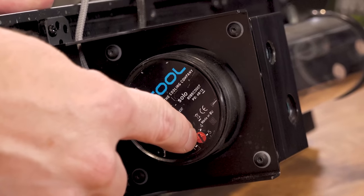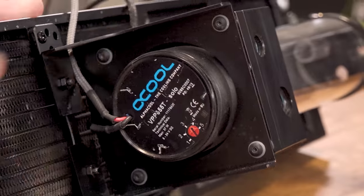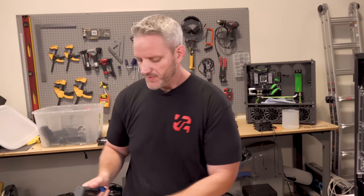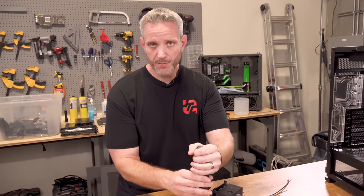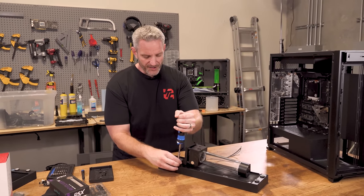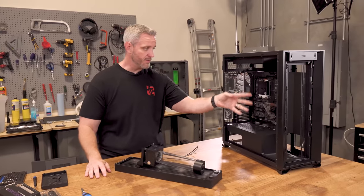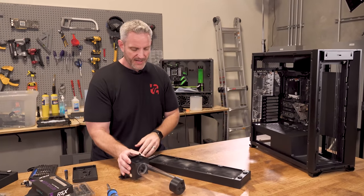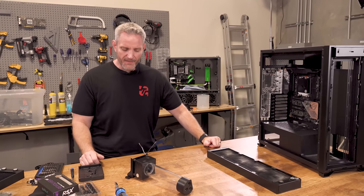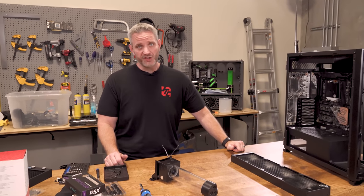This is a non-digital pump, so you have to turn that knob to increase the pump speed. I personally like the non-PWM pumps, because when you're bleeding a system, I don't have the motherboard and stuff on because we don't have all the air out of the system. When it doesn't see a PWM signal, the pump will either default to full speed — which is great for moving pockets of air out of the system — or it defaults to its lowest speed, which does not move air pockets very well.